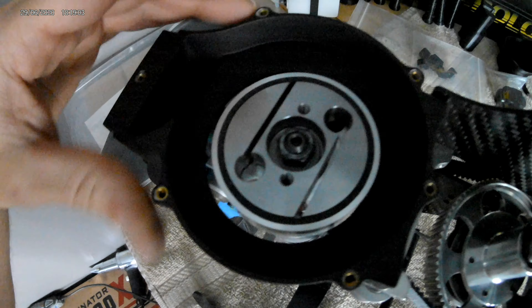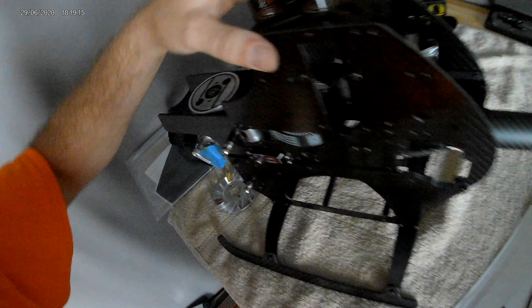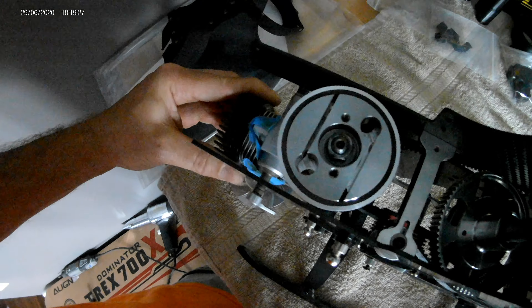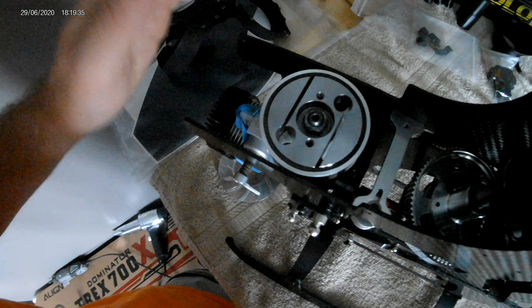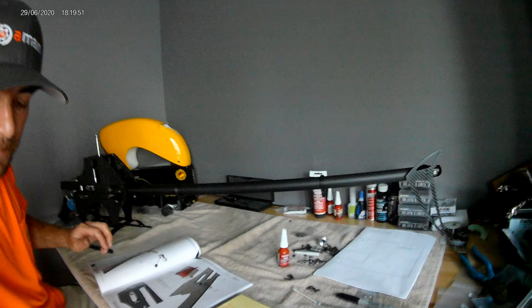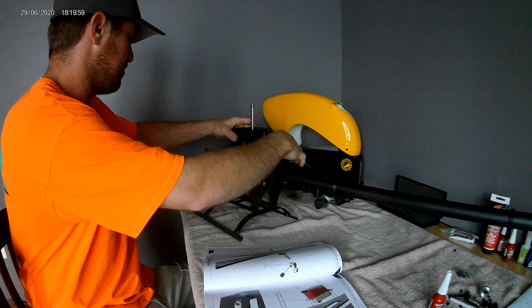You can see there's a perfect gap on the clutch. One important step the manual makes note of: when mounting your engine, you have four screws holding it in — make sure you line it up so it's exactly centered in the frame, with the same gap on both sides of the clutch belt. Take your time and measure it. If it's not square, your belt is going to twist and ride up or down on your pulleys.